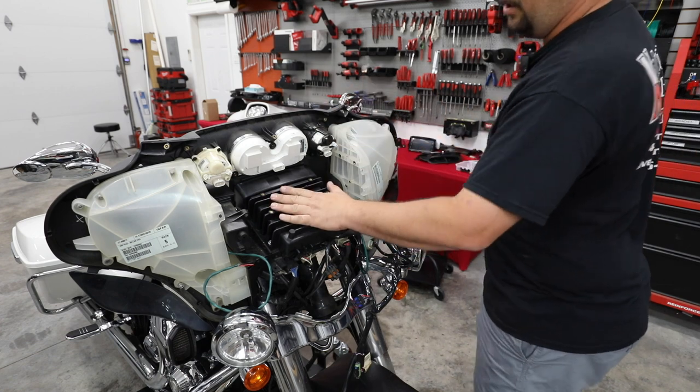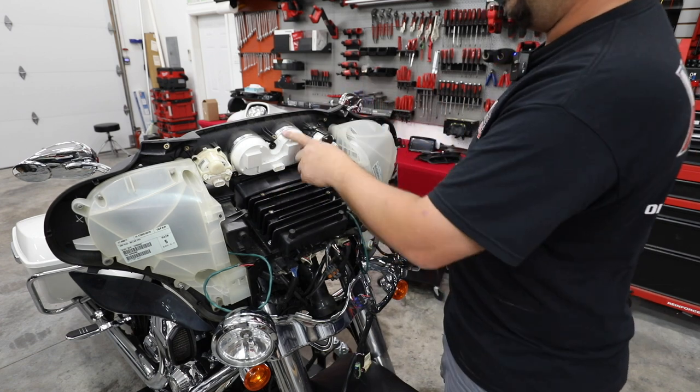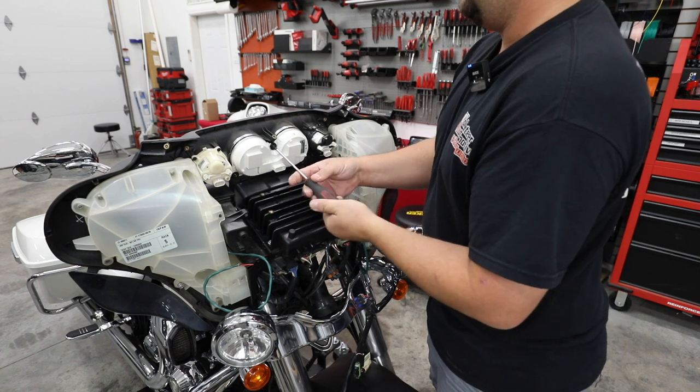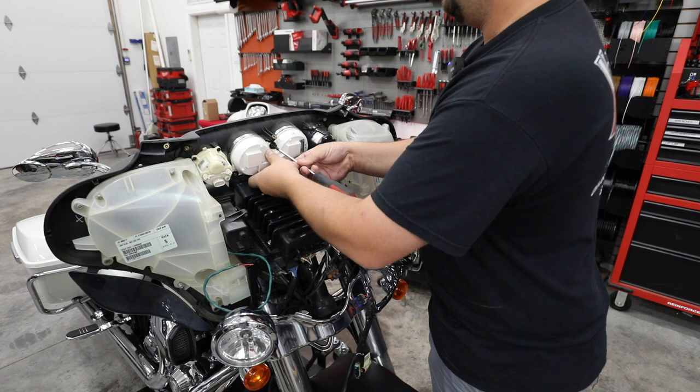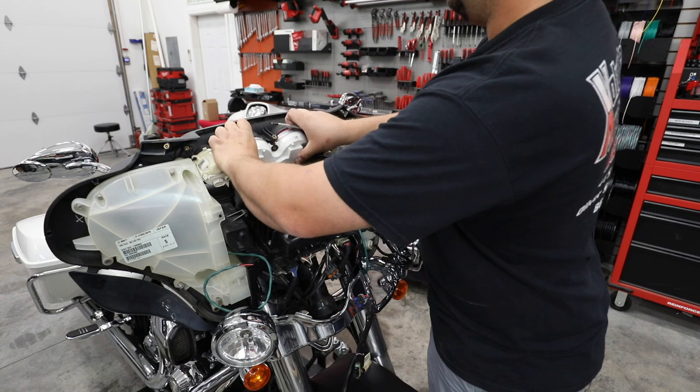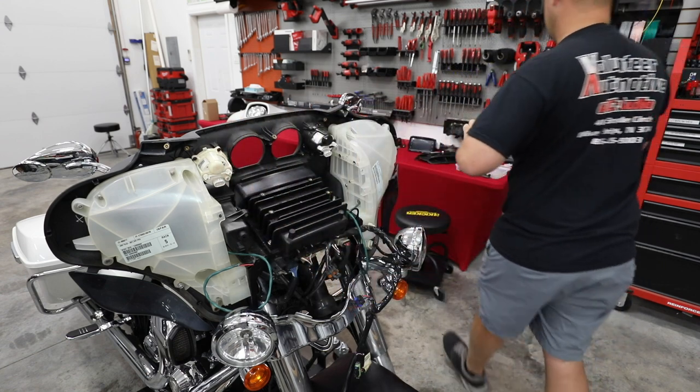And now we have our pocket here, and we're gonna be removing that and putting a radio in, but our speedometer is still in the way. So we're gonna take the top screw out of it now, making sure that we keep up with the trim that's on top of it. It's gonna come off with it, and we're gonna put all that back together here at the end.